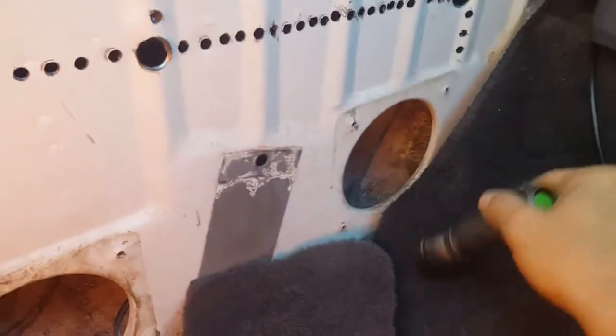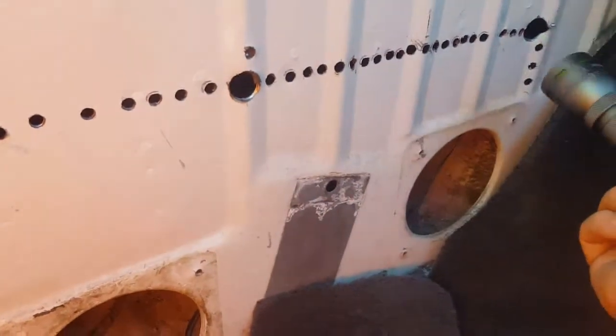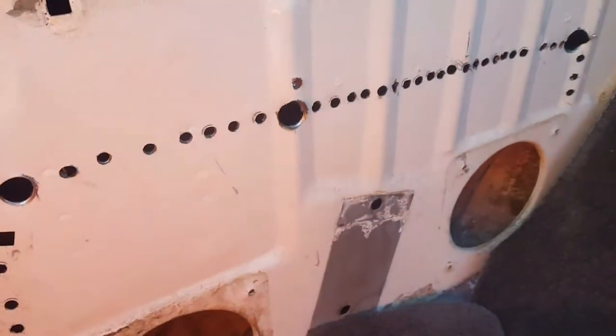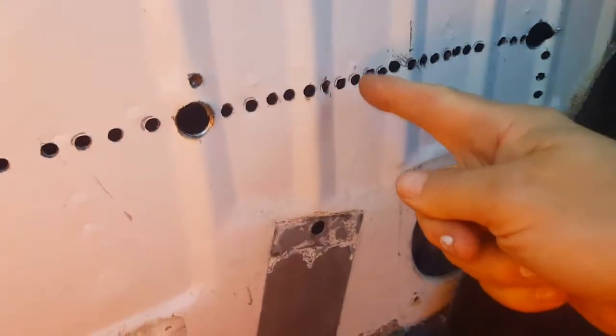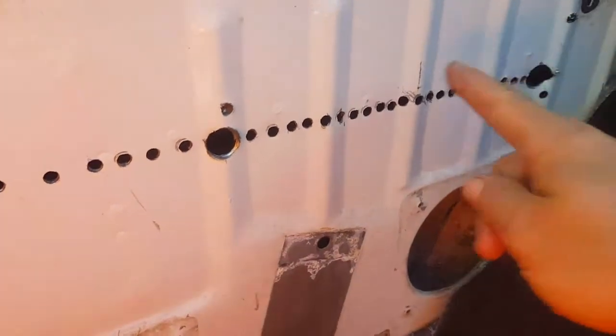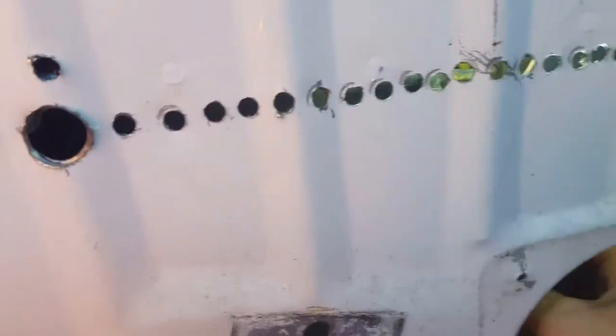You could do this another way if you didn't want to cut out so much. But I'd rather do a bigger area with more hand movement. You could probably cut out just up to where the two holes are and do a nice square one where the pump is. If I put a torch in here, you should be able to see through the holes - there's the pump, you can see the pump there with the fuel line coming out of it.